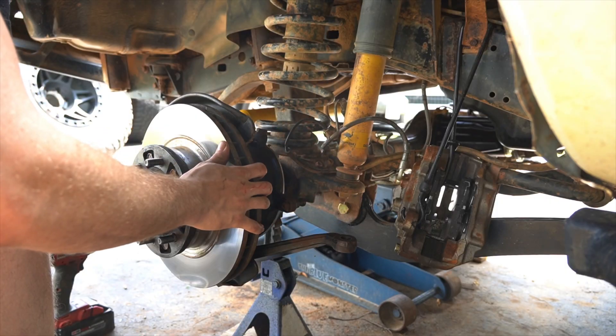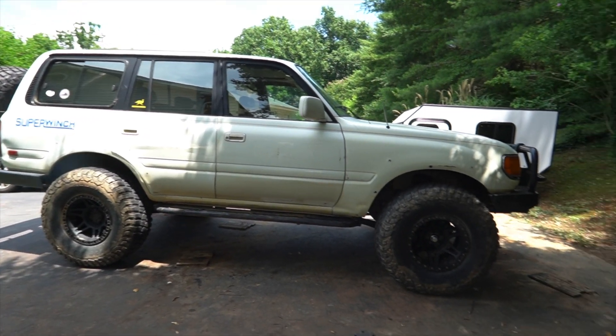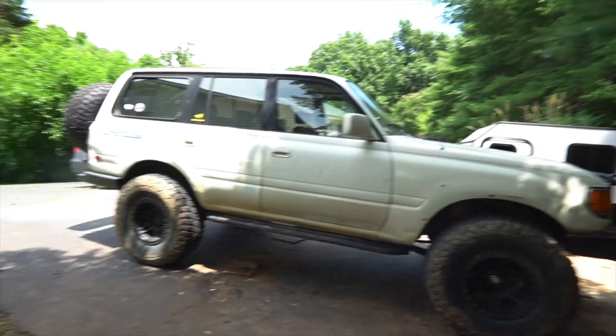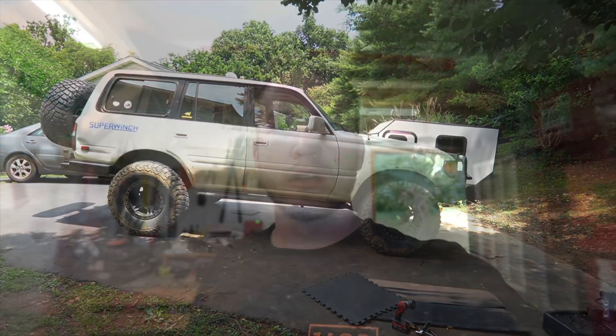The rebuild kit comes with a new dust cap. I'm going to put a little bit of grease in here so as it heats up it keeps the splines a little lubed — the service manual actually recommends that. One thing I want to show you about the Longfield birfield joints: it actually comes with a grease fitting right here, so I'll be able to pull this dust cap off without even pulling the wheel, put a grease gun on this, and pump some grease into the birfield to keep it nicely lubed. That should help it have a nice long service life and make it easy to take care of. Now go ahead and put the brake caliper back on, torque those bolts to 90 foot-pounds, get the tie rod end in on both sides, get the wheels back on, and this is done.